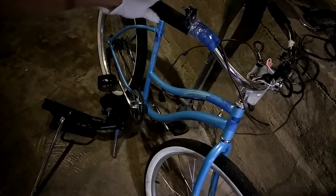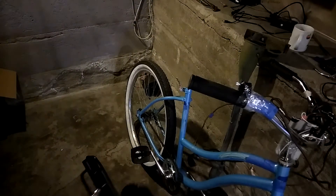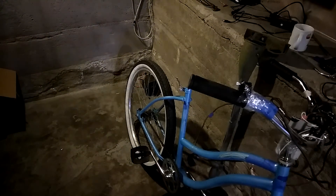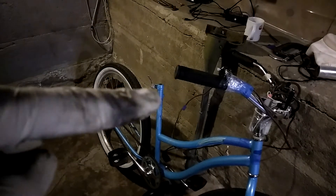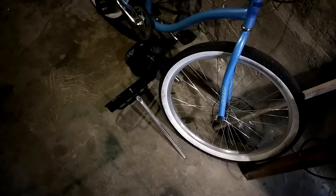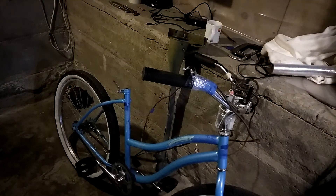Our setup on the bike is going to be a little tricky. I'm going to have to set up the rear somehow, because currently the bike rack bolts to the seat and the seat can move around. I need to make something a lot more solid than this because we're dealing with a lot of torque at 500 watts from that electric wheelchair motor. I'll probably build something that comes straight out from the seat post and then has struts that come down on the sides — all one metal piece, sourced from the hardware store.